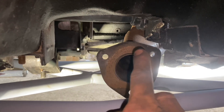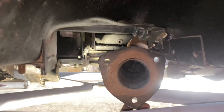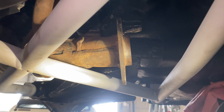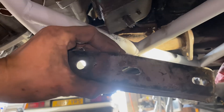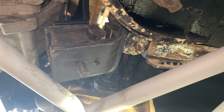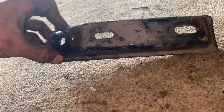I'm just going to have to try and get it somewhere bang in the middle where it sits quite nice. The other thing I might do is get rid of this big flange and run a V-band instead – that should be a bit more neat and tidy as well. It should fit quite nicely if I get it somewhere in the middle around about here. As for the rear mount itself, I've got this big rubber bush and then the original plate that would mount to that bush and onto these points here. I'll see if I can use that, but if it's not sitting right it should be fairly straightforward to modify it so that everything sits right.